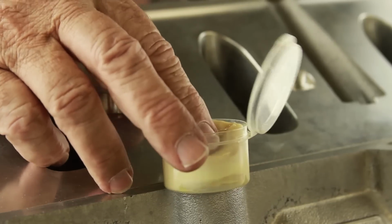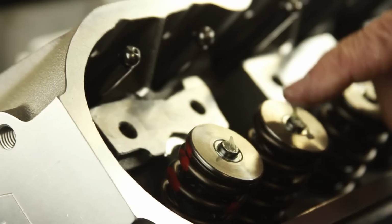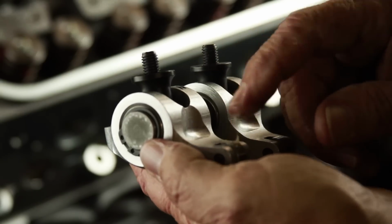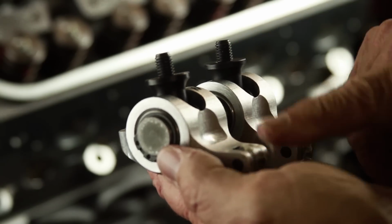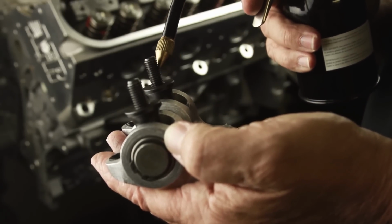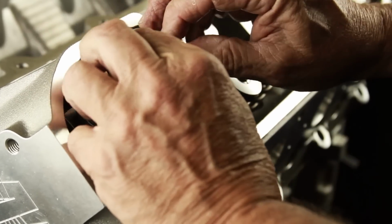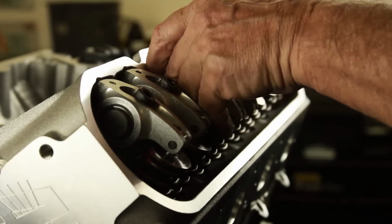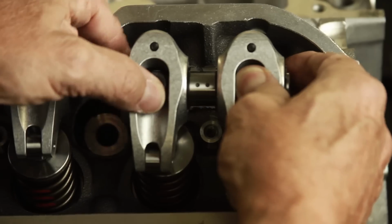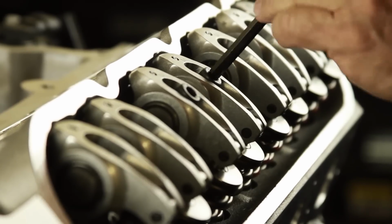Before installing the Yella Terra Ultralite shaft mount rocker arms, place a thin wipe of lithium or assembly lube on each valve tip and pushrod cup. Lube mounting bolts with a thin film of engine oil. Install the first rocker assembly, being careful to align the push rods with the rocker arm pushrod cups. Screw down bolts until they contact the cross shaft.